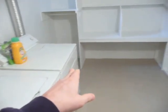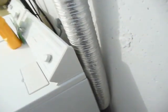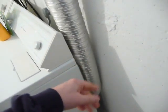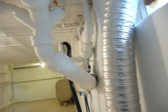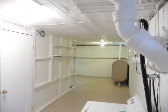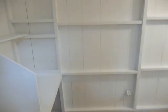I did take the dryer, we put new belts in the dryer on the tumbler, and we've also taken the excess hose that was behind here, and we've cut off probably about 2-3 feet out of that where it's got a direct pipe out now. People need to be mindful when you have excess hose, felt from the dryer lays in that, and it can be a fire hazard. But we've dressed it all up. You know, it's just a really nice job. Real happy and proud of what we did.